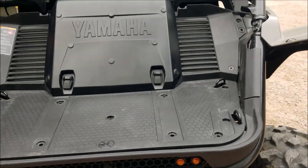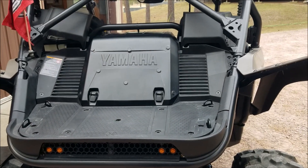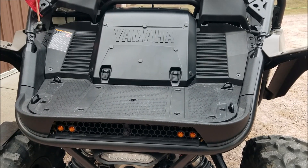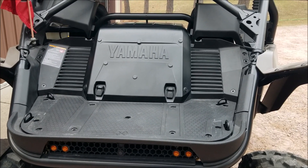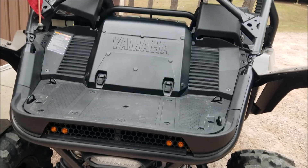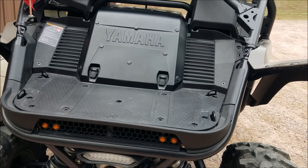The reason for this is in Yamaha's testing with a no windshield versus a front windshield, there were pressure differences. And so if your YXZ was configured one way, it could block cooling off. So they provided multiple avenues of cooling so it wouldn't be choked off.